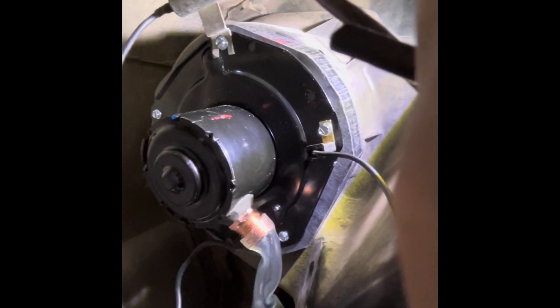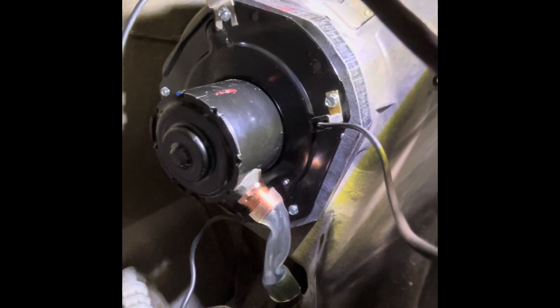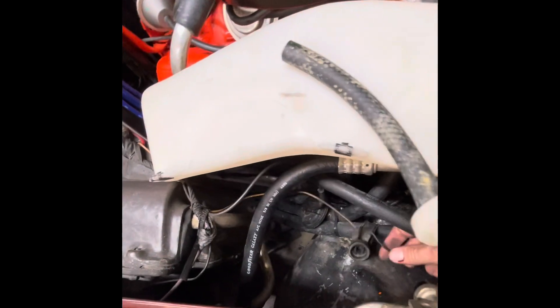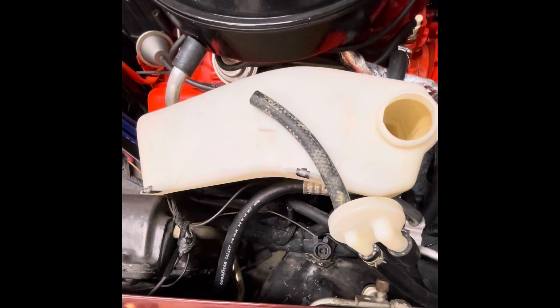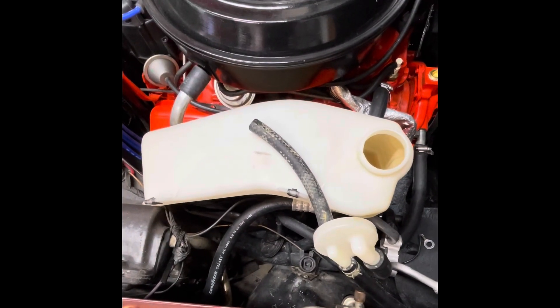Now the screws are tightened on the motor flange. We've got the arrestor back at the top, the ground wire on the next bolt to the right, and the purple main power connector hooked back up on the terminal. I had to improvise on the cooling tube — the radiator hose ended up being too thick and wouldn't bend, so I used some clear fuel line, I believe five-eighths inch, which had to stretch a little on both nipples but looks like it should do the job. Testing the new motor — it definitely has more power; I can feel it rolling back on my face now, whereas before I couldn't. The only remaining steps are to put the reservoir back under the fender, reattach the AC solenoid, add a little more antifreeze to bring the reservoir up to the cold mark, and that's it. Thank you for watching — good luck with your build.